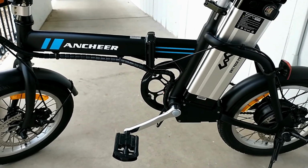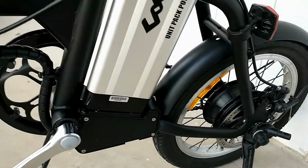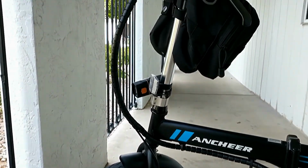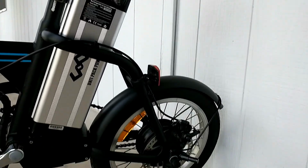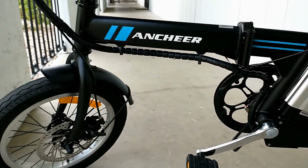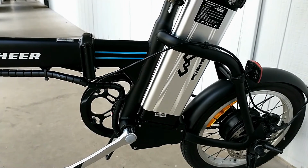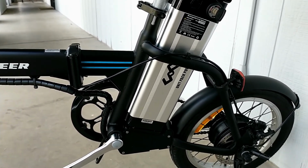And they do have conversion kits, which is nice. You can actually buy the hub and the battery, like I said, the controller module. They have kits where you get pretty much everything you need, except for the bike frame itself. Other ones will give you just the hub, but you have to install the whole hub, which means you have to put the hub in the wheel yourself. Other ones will give you the wheel. There's such a variance of kits. They all vary in price. It'd be a few hundred, $300 to $400 starting. Some of these kits I've seen at, I think, $200 starting out. Some don't include big batteries, and some don't include a battery at all.